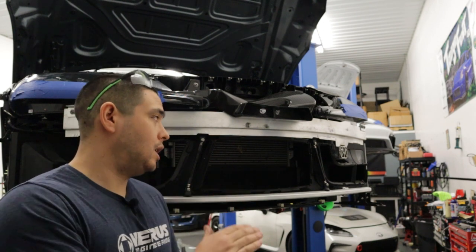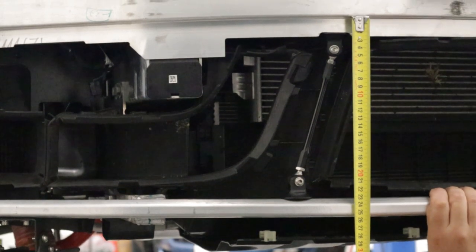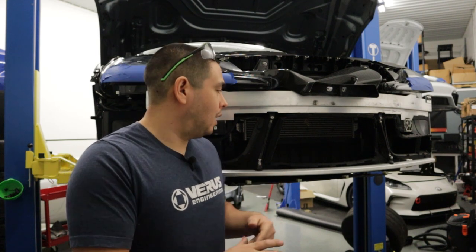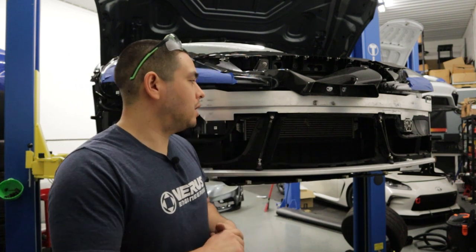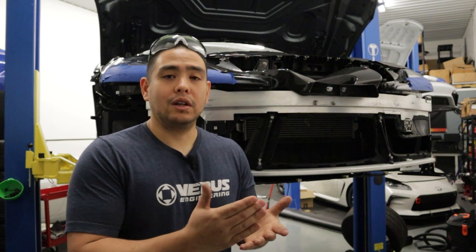We're going to grab Eric and see the amount of deflection that has been reduced. We are post-install — 255 millimeters baseline, Tom's hanging on it and we go to 256, so about a millimeter of deflection. We dropped it 80% — six millimeters down to one millimeter. As you can see, we pretty much eliminated all of the deflection, which is a good result. That's the end of the install. I hope you like this quick and dirty solution that is nice and clean — you don't see anything on the outside of the car, and it should aid in performance benefits for your standard or high downforce front splitter. That's going to conclude the video. If you guys have any questions, comments, or concerns, be sure to send us an email at sales@varis-engineering.com. Until next time, we'll see you later.